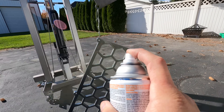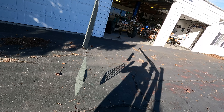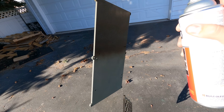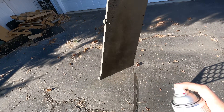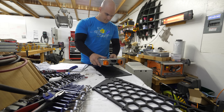AR500 is still made out of steel though. Since it's going to be living underneath the Humvee as we're driving around on regular roads, there's a chance it could get wet and rust. So I'm going to hit it with some self-etching primer, and once that's dry, hit it again with some undercarriage paint — a thick durable black paint that will keep the metal from rusting. Fun little not-so-fun fact: we forgot to laser out one of the mounting holes in the bottom of the AR500, the super super hard stuff. So we burned through five different drill bits on the drill press trying to drill out that hole until we got a solid carbide bit that was able to finally drill through. If you ever plan on working with AR500, make sure you get all the laser holes in the right spot the first time — that stuff is difficult to work with.